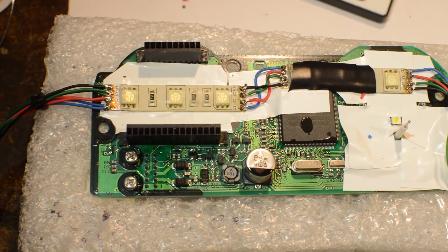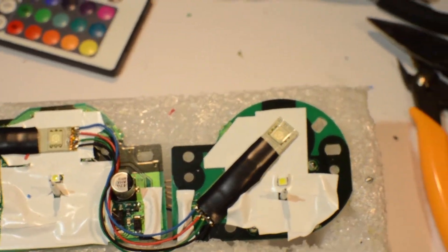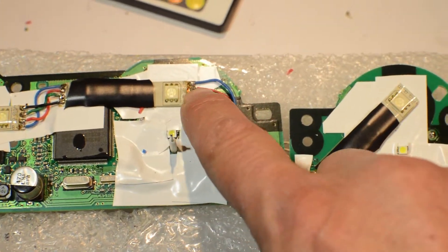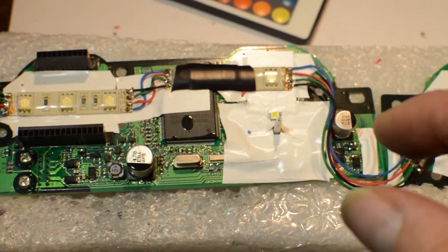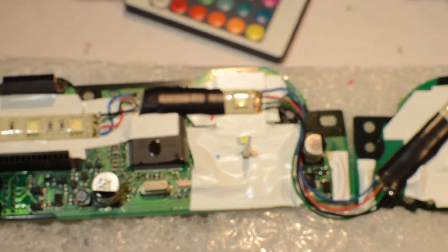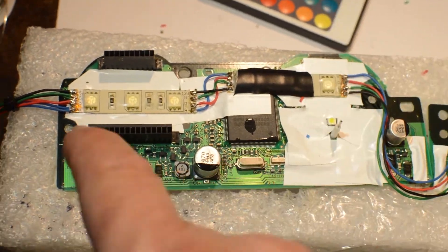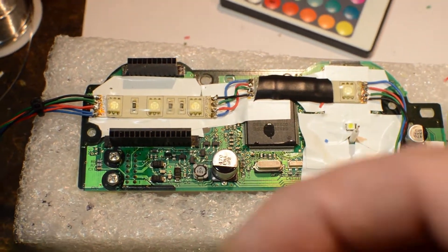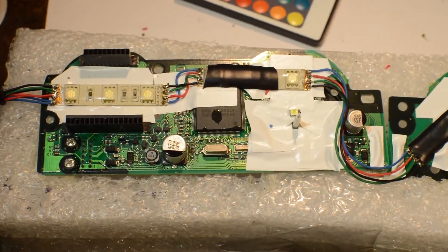All right, big Brian, here's your center cluster and notes to myself for the next time I do this. I'm fixing to make one of these for somebody in Abu Dhabi. I've covered up the extra two RGB LEDs and put them right where the originals should be — I removed all the LEDs. I used white plastic electrical tape for a good background color so none of the exposed metal contacts will short out anything on the gauge. I've doubled the wiring so one string goes to the power supply and one string goes to the main cluster, which is over here in a box to my left.